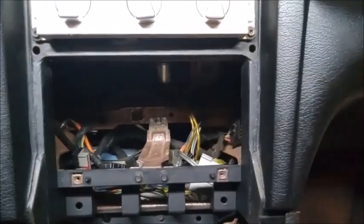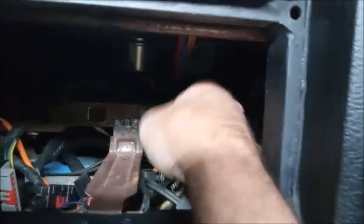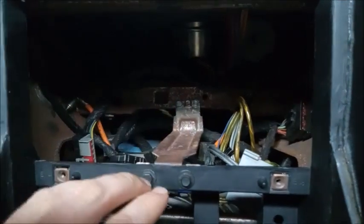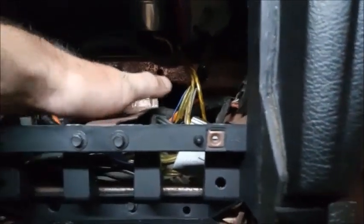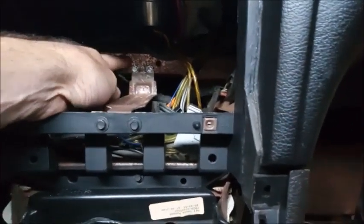And then once it's dry, you take your metal piece. Now this piece, like I said, it's kicked up in the back the last half inch. So flatten that section out, so this whole piece will just be flat and straight. And once you get that straight, take this piece, put it in there after it's been flattened, and bolt it down to where this is even on the top, and it'll go past this metal bracket below it. Take a straight edge, put it up against this back metal piece, and make a mark that goes across this cross brace, and that'll be the spot where you bend it up 90 degrees to where it'll be flat with this piece in the back.